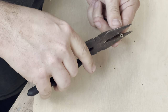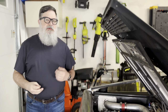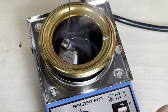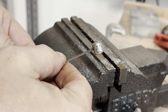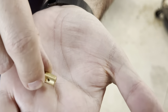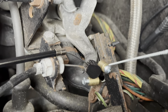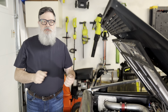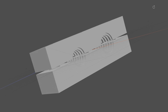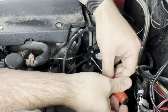I crimped down ferrules with a pair of pliers. I was worried about collapsing the sheath, but it's sturdier than I thought and wasn't affected. I cut off a length of cable and put a proper barrel on one end with solder. It's not the prettiest solder job, but it gets the job done and it's plenty strong. For the other end I'm using screw-style cable stops — they're easy to adjust and I've had them on other cables for tens of thousands of miles without issue. The sheath needs to be anchored to stop it from flexing and keep the cable from rubbing against the bracket, so I printed a clamp that binds my cable to the transmission cable, going through a few versions to get the right tightness without the cable slipping out.